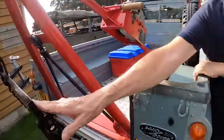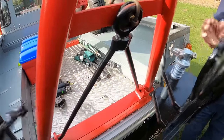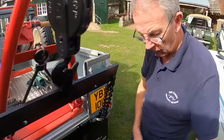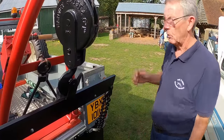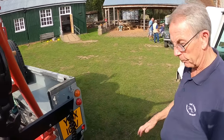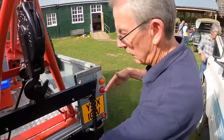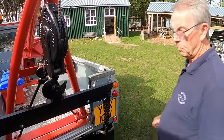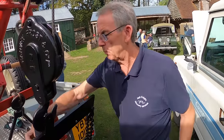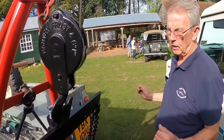And then when this is down, this A bar, that's called the A bar, goes in that on there. Like that. Oh, I see, yeah. You can see it. So this ring goes into there. Another name for it is anti-sway bar, because if you just had this hanging down with the chains, I see, like that, you see. So you put that in there. What you do, you'd let this down, get on the front of the car, and push it back a bit. Well, you put them chains under first on your suspension, come up, hook it wherever you had to, put an old cushion in there, stop it scratching the car. Yep. And then you put your back on it, push it on that, push it back a little bit, and let that down into that hole. Yes. And then let it come off, and you drop it in, you know. And that being triangulated is the rigidity. Gives you the rigidity to stop that twist. Yeah. It stops it swaying like that.